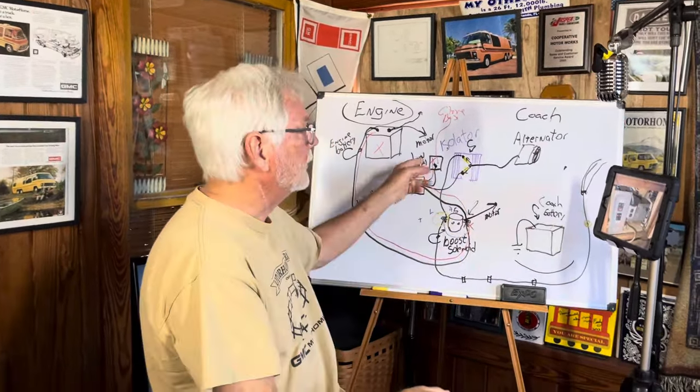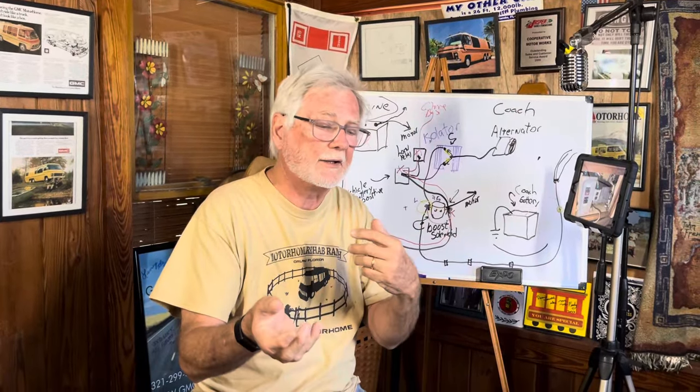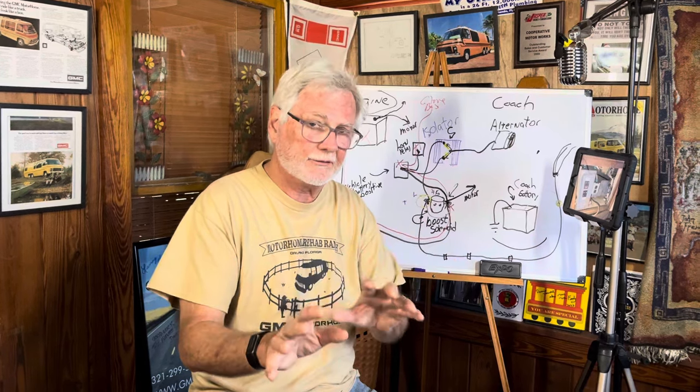So go through and check all your parking lights — see what you've got. You may need to wiggle things. You may want to take some tuner cleaner, spray in there, get a little bit of corrosion — get all that stuff out.